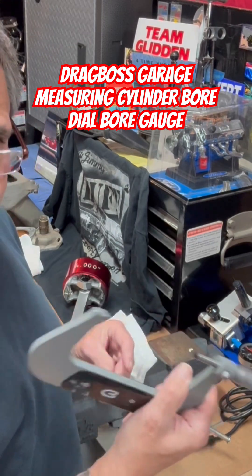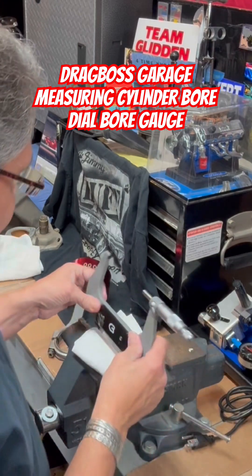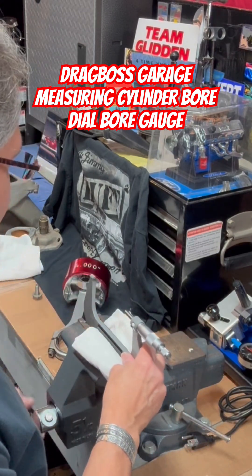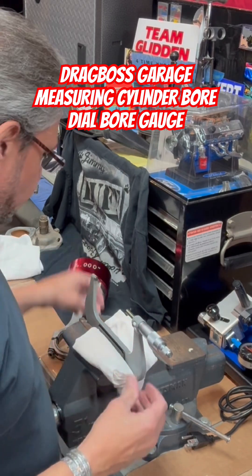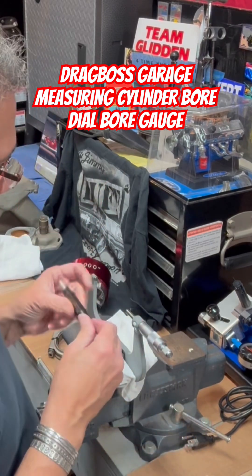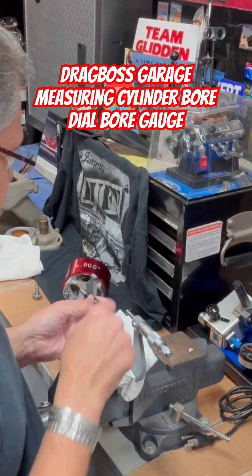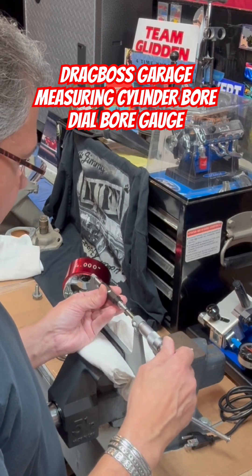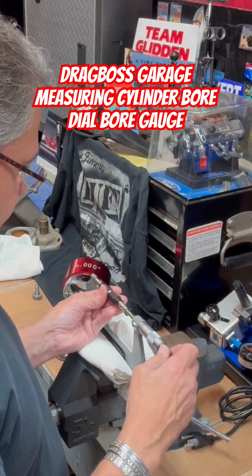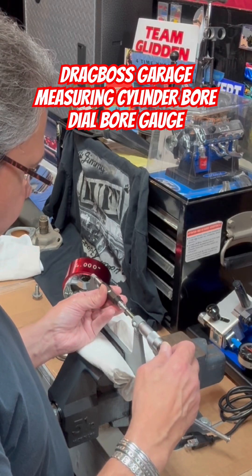To do that, you need a micrometer. This is a four-to-five. The bore is 4.015. The first thing you do is make sure that the micrometer is accurate, so I put it in a vise with some padding — I don't tighten it too much. You want to measure a standard; this is a four-inch standard. Lots of things contribute to this — temperature can even contribute, and the location of the standard can also affect it, so you want it as square as you can.